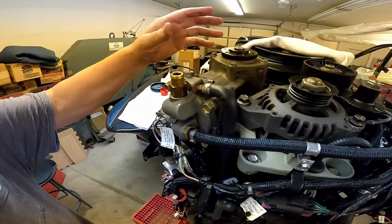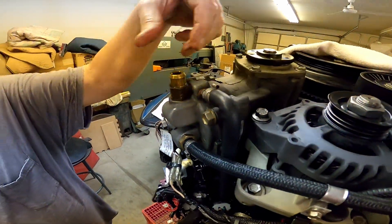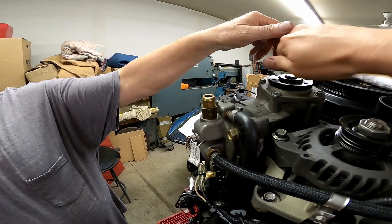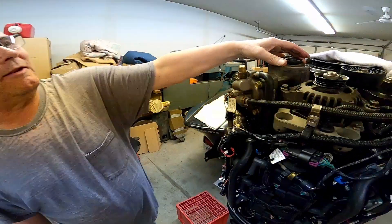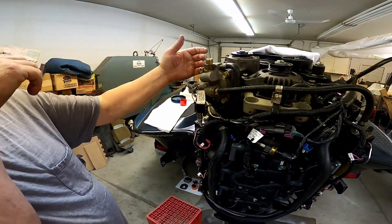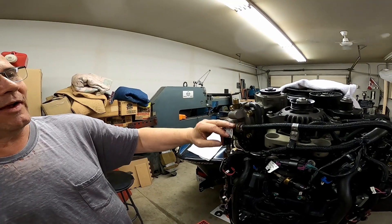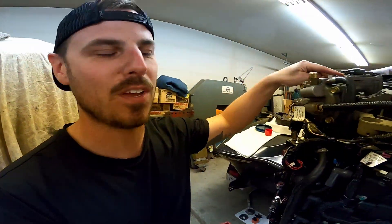This compressor never just broke — it was breaking. It was slowly disintegrating, coming apart. You could hear the crank noise, like knocking. No compression — you could spin it with your fingertips. So anyway, we're going to look at it and see how much wear is on the crank pin or the bearing. Regardless, it's failed — the bore could be scored, or there's gap in the piston rings, and there's metal working past that into the airlines going into your injection system. So it needs to be clean. Now we're going to show you what the inside of an original compressor that's failing looks like. So here's our new compressor — that's the most current part number today, 2023 — which we had to get brought in from Pensacola, Florida, because there's none in the system in any Mercury warehouse in Canada currently.